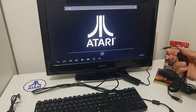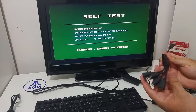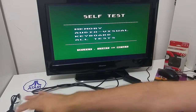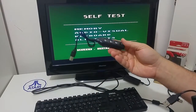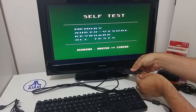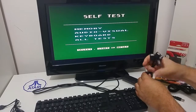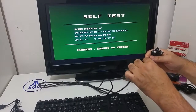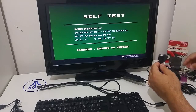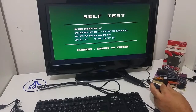When it does that, I'm going to connect to the second USB port a USB hub — this is a simple 4-port USB hub. I found that some USB hubs do not work well with the Android operating system and some work better, so just connect the one that works better. To the USB hub I'm going to add a USB keyboard and a USB mouse.